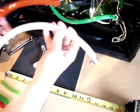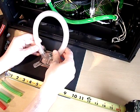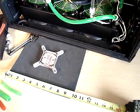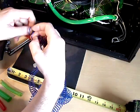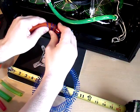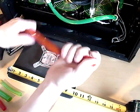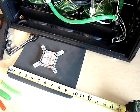I have a piece of tube here that's a bit longer - just leftovers from my previous build, about 20% more. If I do the same connection, no problem, because the bending diameter is bigger. Another solution to keep in mind is anti-kink coils - you just put them around your tubing and it gives a little more protection. I prefer to plan my loop so I don't need to use them. Just use proper turns and proper fittings so your build looks nice and professional.